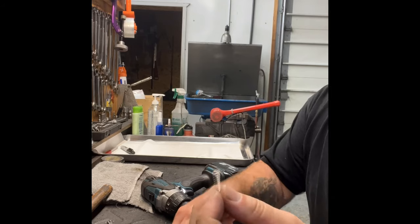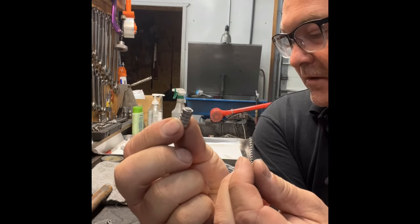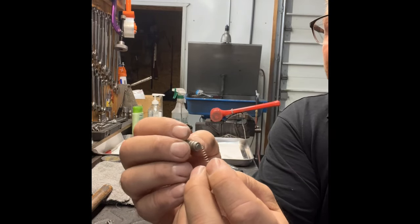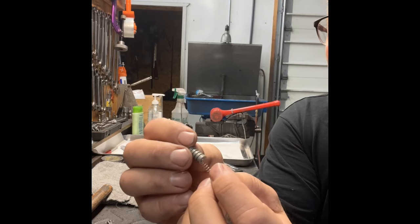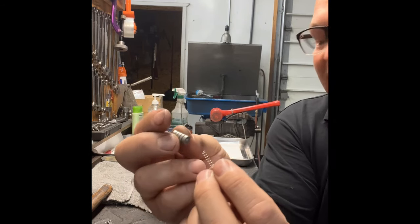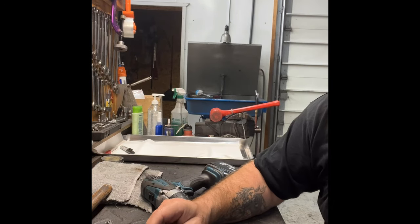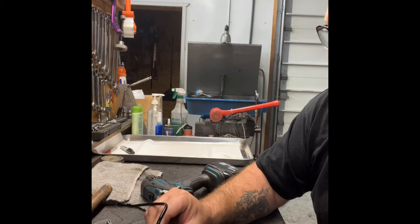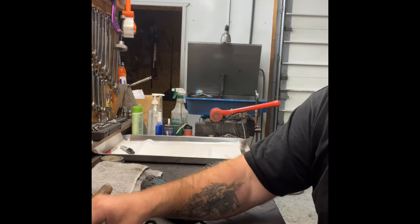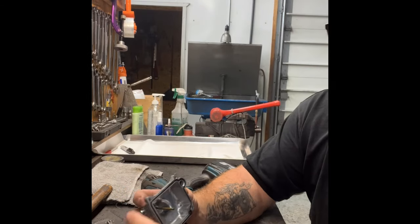Be careful — a spring and your accelerator plunger will come out of the carburetor. Over time this plunger will corrode and stop working, and typically you won't notice any difference. You don't have to run the accelerator pump spring and plunger, but I usually keep it in to avoid creating any vacuum leaks.